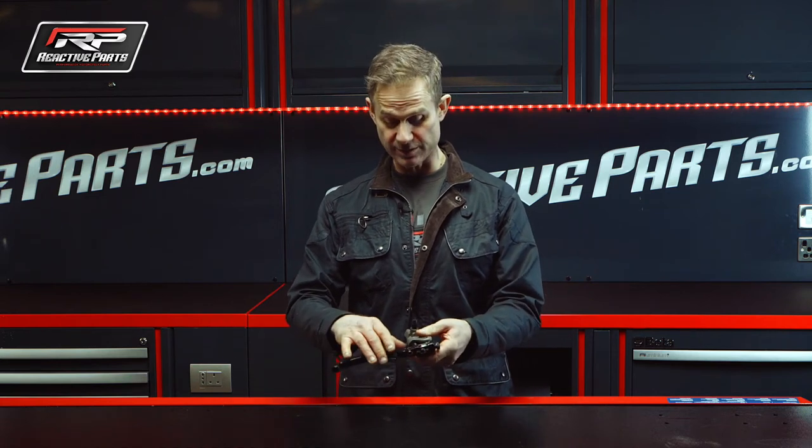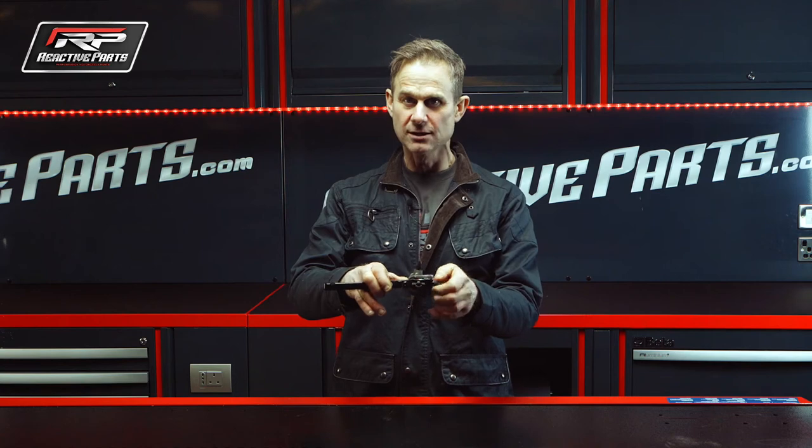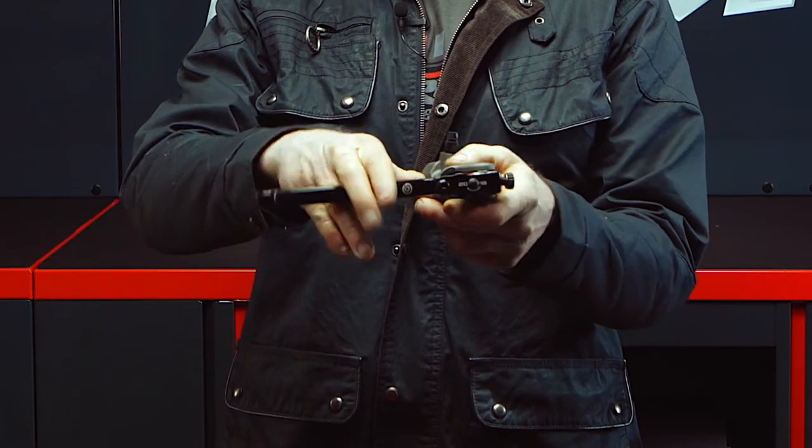What's good about it? We're used to seeing adjustable levers — all standard bikes these days are fitted with such — but this is adjustable, both where the lever bites and where the fulcrum point is. This means if you brake with one finger you can have more power, or wind it out. Two fingers, less power. Some people even use the full hand, but there's less feeling in the lever that way.